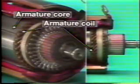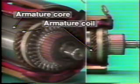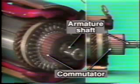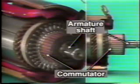One of the armature components is an armature core, which is grooved so that the armature coils can be wrapped around the armature core along the grooves. Both ends of each coil are connected to the commutator. The torque generated at each coil is combined to rotate the armature, that is, the armature shaft.